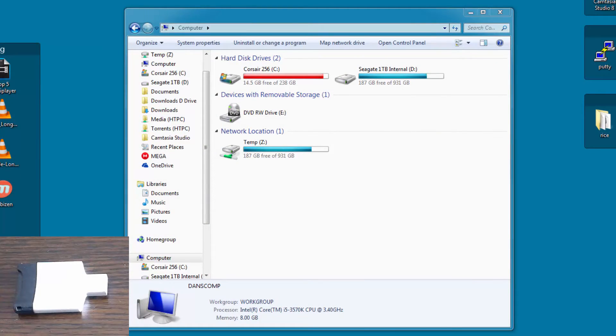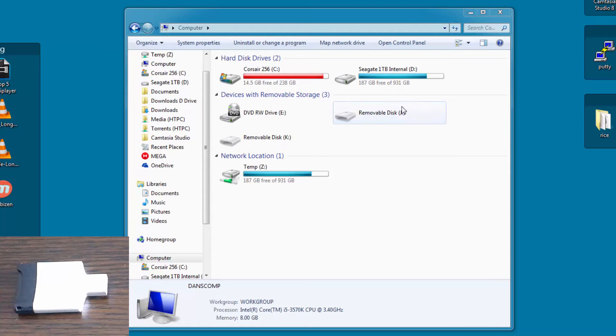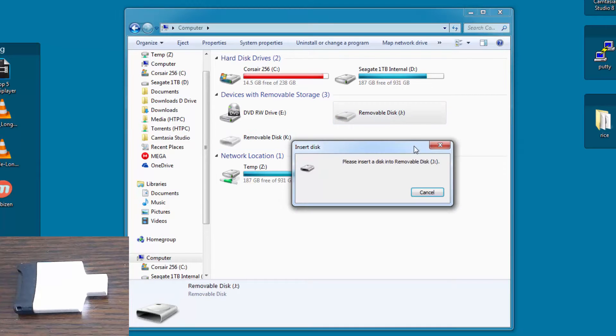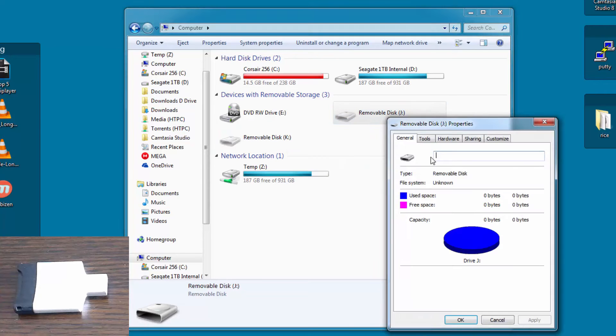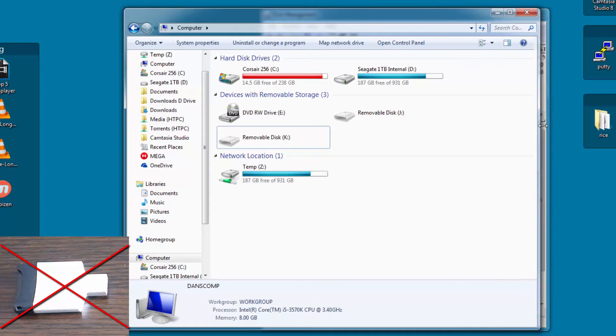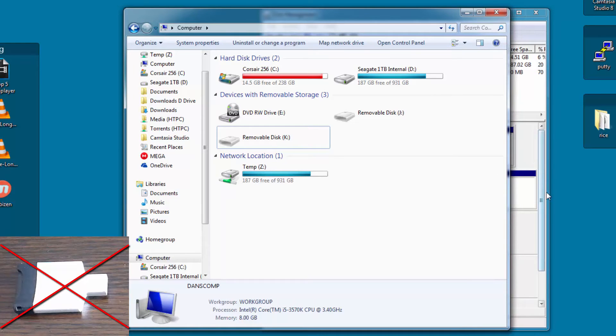Open up My Computer and connect your SD card reader to your PC. Now my reader is connected, and Windows has loaded up two additional drives shown here as J and K. Neither of these drives have a size associated with them — I cannot format them, and if I look at them in Disk Manager there is no information about them at all. If you are experiencing symptoms like this, unfortunately your card reader is not compatible with the eMMC SD adapter.